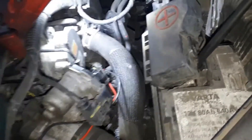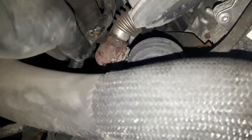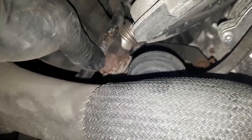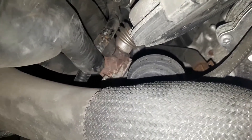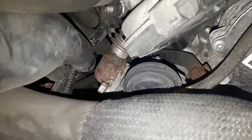I've removed the battery and removed the wires from their clip — and look what I found. The wires have been touching the EGR pipe, and because of the vibrations the insulation has peeled off. You can see a wire that's touching ground there, and I think it is exactly our five-volt reference wire — there's a little cut in the insulation and it's touching the ground.